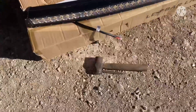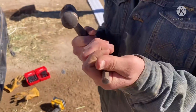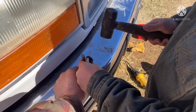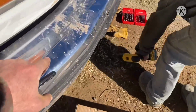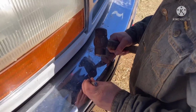All right, right here on the ground, got a couple of tools for you. You know what that is? Chisel. Hammer and a punch. That's a center punch. Put that punch over here. Put it right down in there, right in the center. All right. Give it a couple of strong, not a bunch of them, just one real strong whack with the flat side of your hammer. All right. Whoa. Okay. Pick one of those little dots that you think is the right one, and make a little stronger hole with your punch. I think that middle one, right? Choose the one in the middle.